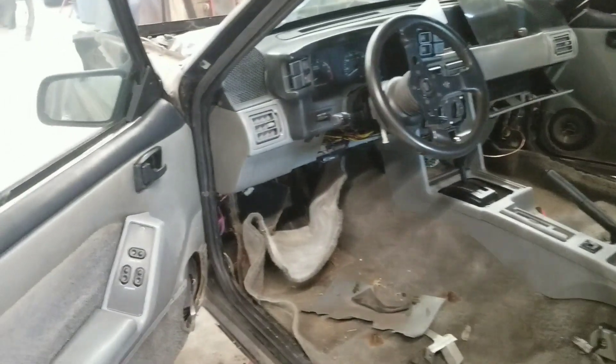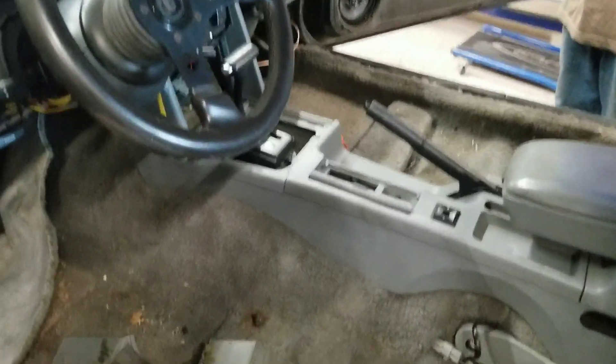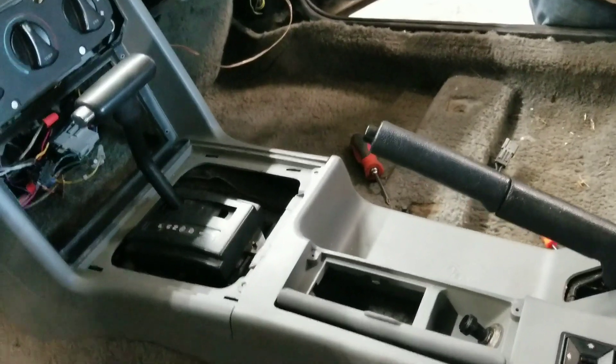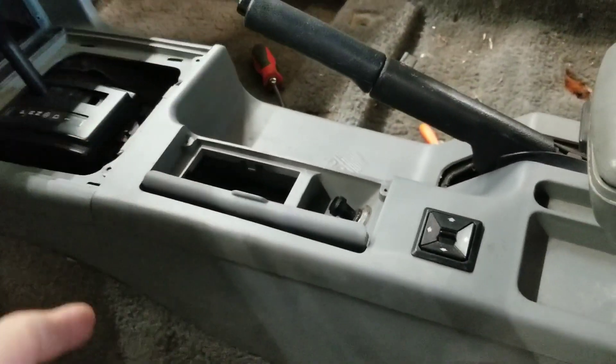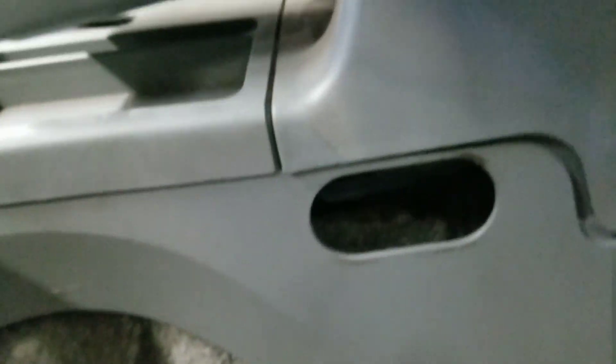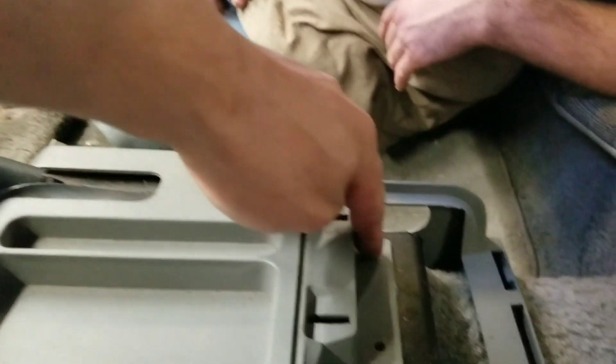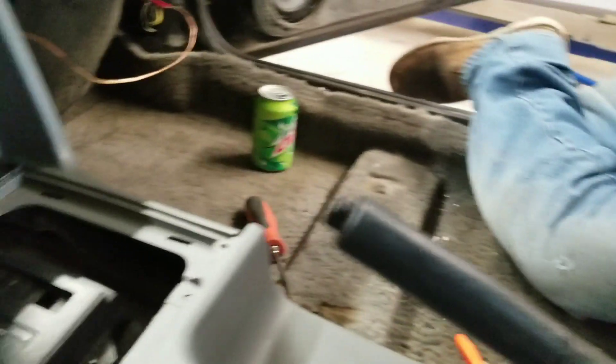As far as the inside goes, it was four 15-millimeter bolts per seat and then we took them out. We've got to pull this center console out — it's pretty simple. There's a trim ring around the shifter, pull it off, pull the stereo, unplug it, and then you've got these little plugs here in these holes — pull those out. There are four 8-millimeter bolts, two in each side. Then this comes out of the way. Then there'll be a Phillips screw here, here, here, and here — pull them out and this slides out of the way.